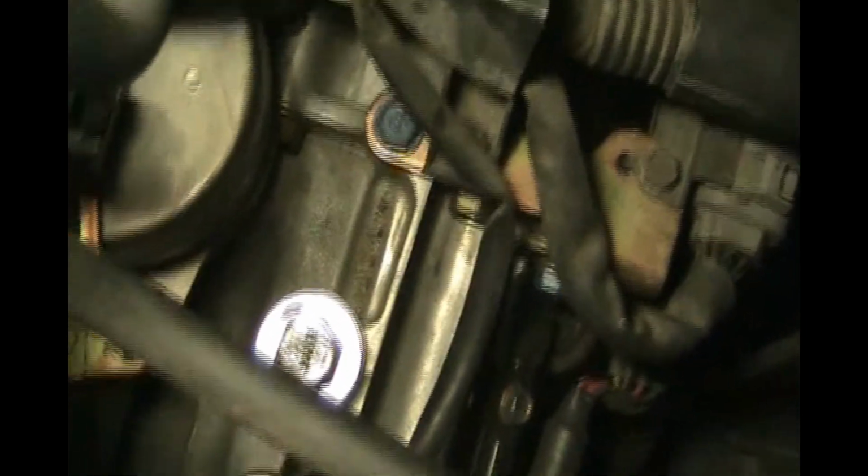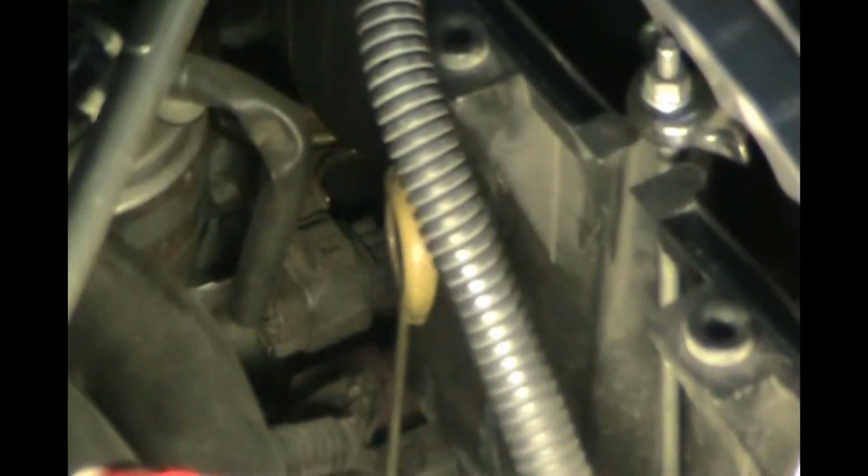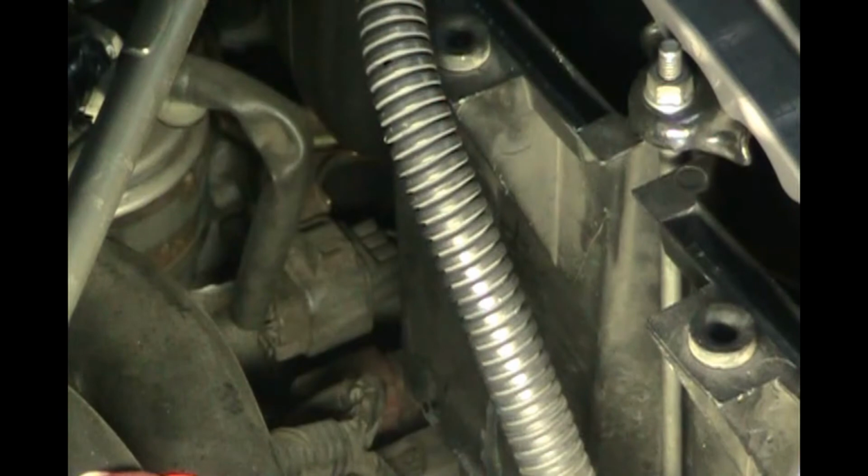Okay, so our fill plug is in, and now it's time to check the dipstick, which is the yellow dipstick next to the battery. So there we go. There's our yellow ATF dipstick. Let's pull that out and we will check that. Let's get that dipstick out, wipe it, and put it back in. So that's good for now because we have not run the transmission. We need to circulate that fluid.